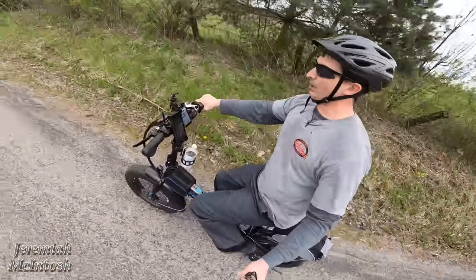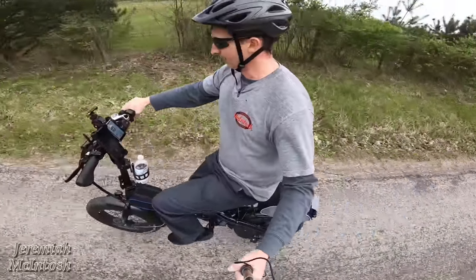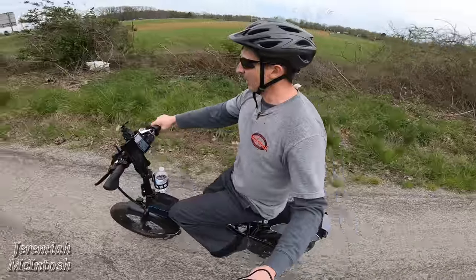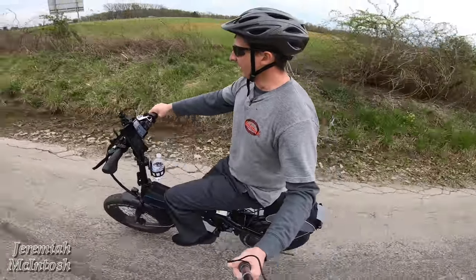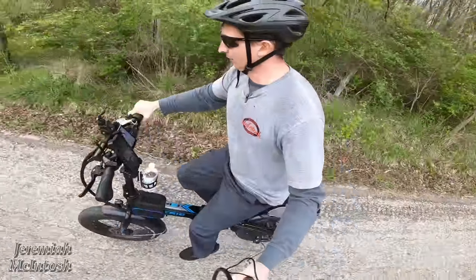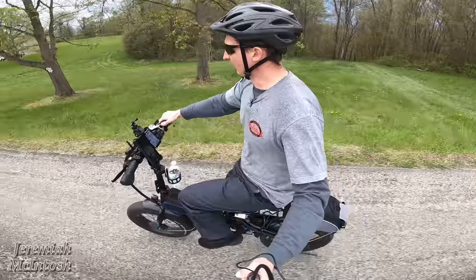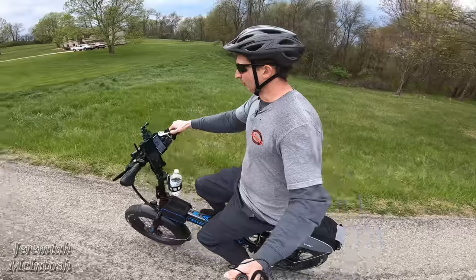This isn't only for people that want to go over 20 miles per hour. If you want to travel on level ground in PAS 1, seventh gear with the new freewheel, this is what it would be like — around nine miles per hour. So that's not bad at all. If you're on level ground and don't want to pedal fast, the old gearing would give you somewhere around nine miles per hour in seventh gear, and this will be the new gearing equivalent.